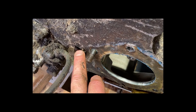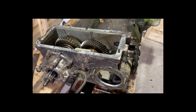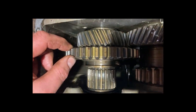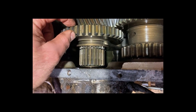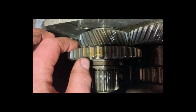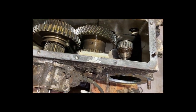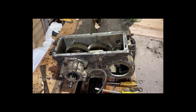Cup of tea time. I've got to somehow get this shaft to come out. I think it was a pry bar under there and lever it back, but guess what I haven't got. So I'm going to have a cup of tea and then route about in the workshop to find a small pry bar. I don't know how tight that's supposed to be, but I've got to assume it would be more snug than that. It's got a slide so I guess there's clearances, but that looks excessive. No end play on that — and that's the main input shaft. The needle roller bearing sits inside the end of the overdrive unit.